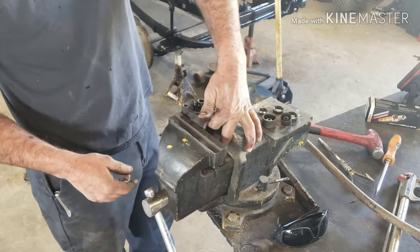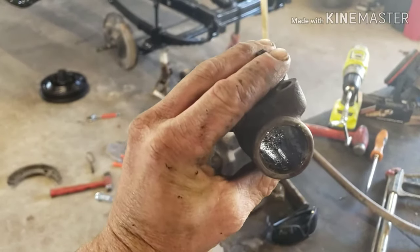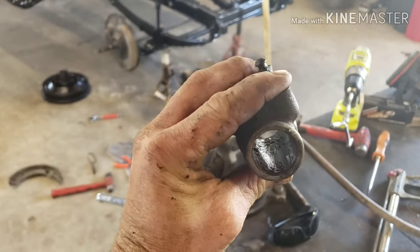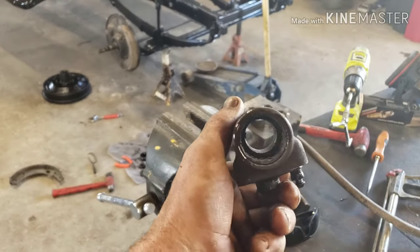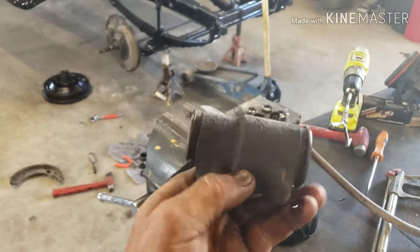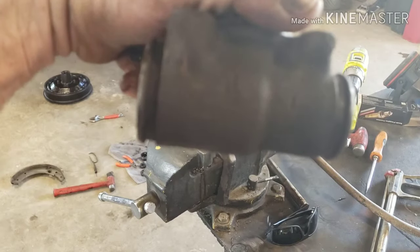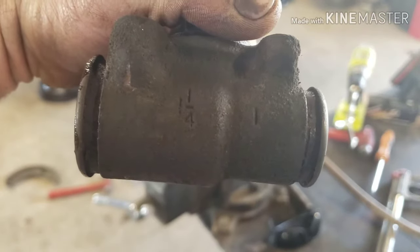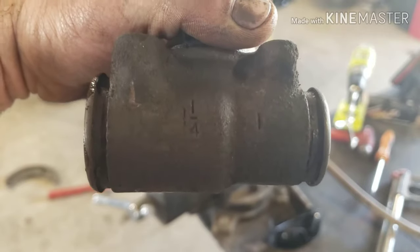Now we can get a cylinder hone and try to clean these up and see if it's gonna work. The first thing we're gonna do is clean this up — it's pretty gross, but because it's all just old brake fluid it's actually not very rusted; I think this is going to clean up pretty good. An interesting thing about these old 1940s-model wheel cylinders: you have two different barrel sizes, so your piston cups have two different sizes. It looks like we've got a one-inch and an inch-and-a-quarter. And that's exactly what our piston cups say in the new kit, so looks like we got the right kit.